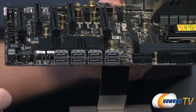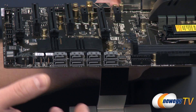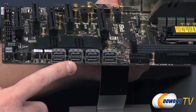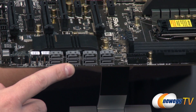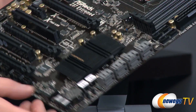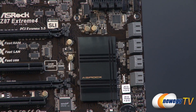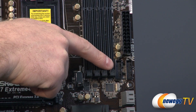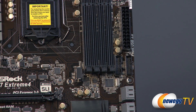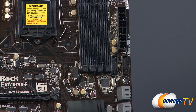All of these being Serial ATA Revision 3 means they can do six gigabits per second, so whether you're plugging in a mechanical hard drive or a state-of-the-art current-gen SSD, you're going to get the maximum performance available. Moving up the side of the board, there are a couple USB 3.0 headers — both the 20-pin — so you can have plenty of USB 3.0 front panel connectivity. It's nice that we're finally starting to get more than one of those available on motherboards.